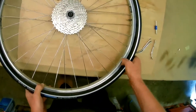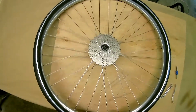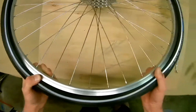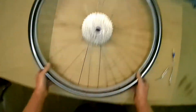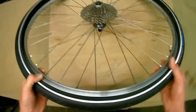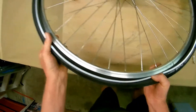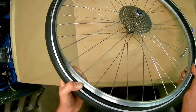Make sure the tire is seating around there reasonably, because you don't want it pinching. Start the area furthest away from the valve — the idea is you can get the carcass inside the rim and when you get to the end you can push the inner tube up to get access to the rim without pinching the tube.